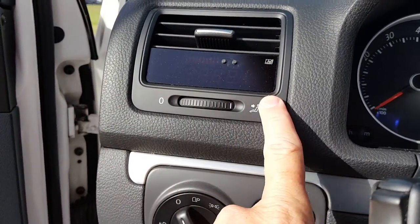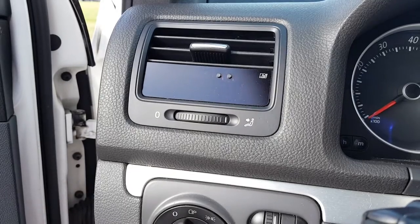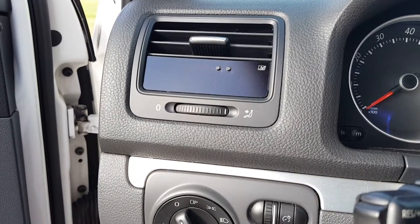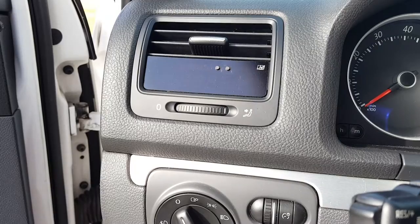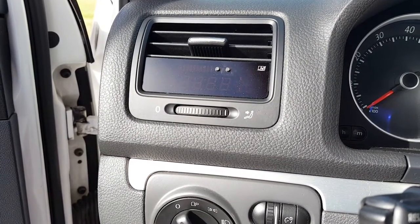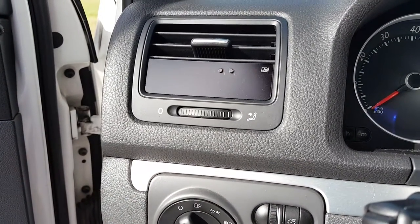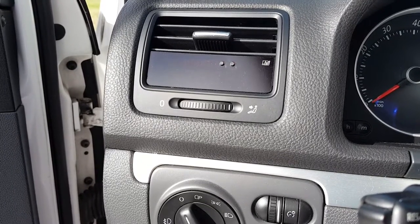I found another good reason to have the P3 Dash digital video gauge — it also tells you codes that go bad in your engine. My gas cap light came on, I took off the gas cap and dried it out. It was a very cold night. I put the gas cap back on, started up the engine, and it went away. But the next day I drove down the road and the check engine light came on. When I started the engine, it showed code 0446, so I looked it up online — basically it means there's a slight emissions leak from your gas cap.